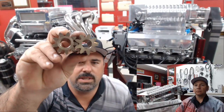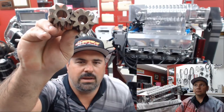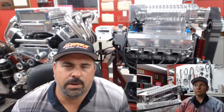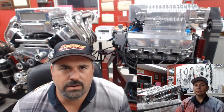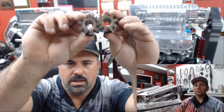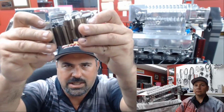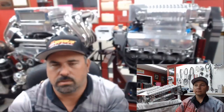Inside the pump you've probably seen these gear sets — this is basically the inside of either a wet or dry sump oil pump system. It's basically two gears, and as they move across each other they create a vacuum and a pressure state for moving oil. There are different things you can do with the clearances of these gears — how far apart they are, how tight the case is on top. The tighter the clearance, the more sealed the pump.